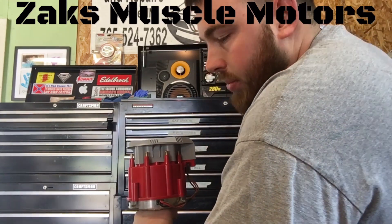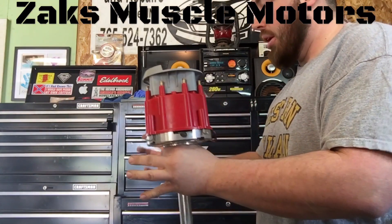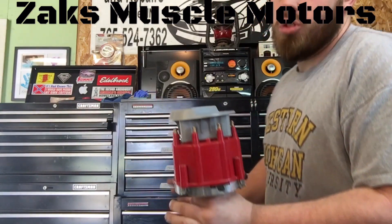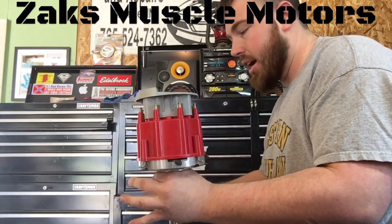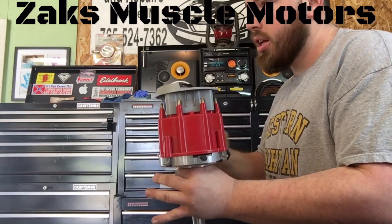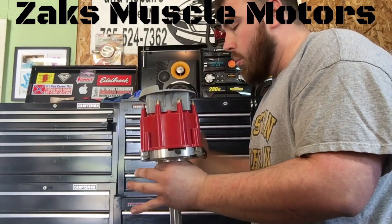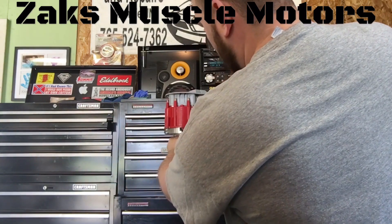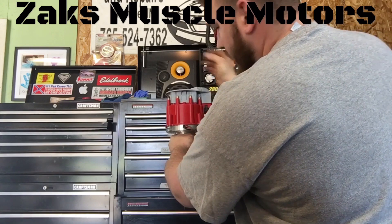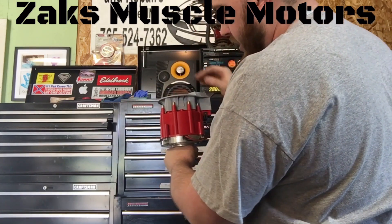Find your number one cylinder — it's easy to find. When you're looking at the front of your motor, your number one cylinder on a small block Chevy is always the front one on the right-hand side of you, or if you're sitting inside the vehicle, the farthest one from you on the driver's side. Looking at it: one, three, five, and seven on the driver's side; two, four, six, eight on the passenger side of the vehicle.